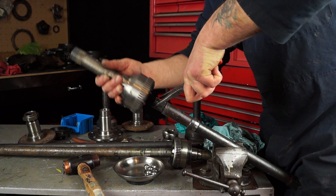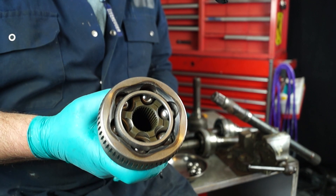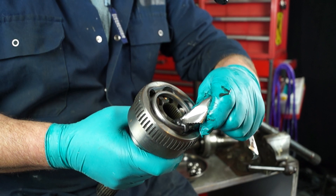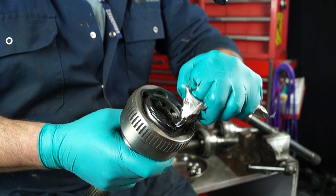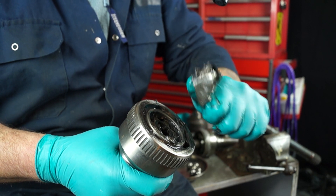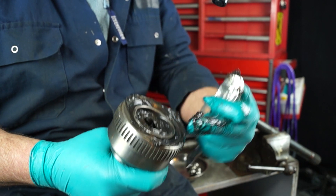So after a dry run, once it's greased up, the clip can be put on, squeezed into place and the CV can be banged on. Greasing up the CV joint is a matter of putting lubricant into the assembly. You get this packet with your CV joint kit and we just shove it in — working it in so all the faces, the balls, and everything else are lubricated, with a little bit of reserve left for while it's working. Because you will get grease in here, however it still needs to be lubricated. Never fit an assembly dry.